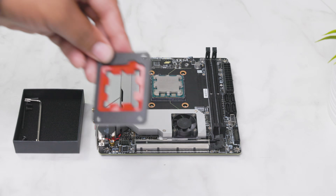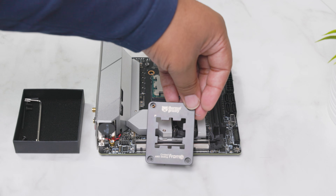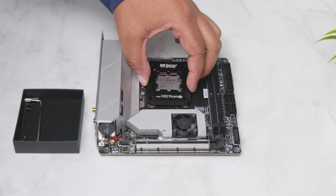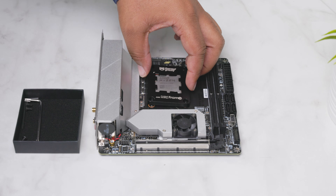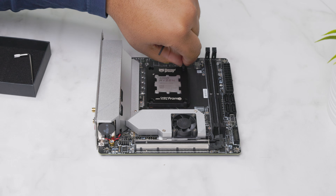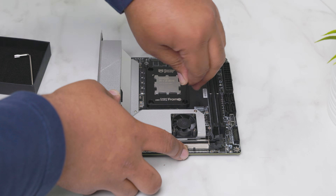I received this Thermal Grizzly contact sealing frame from a subscriber, and it has helped prevent thermal paste from creeping in — much appreciation to him. There is a silicone gasket that wraps around the IHS for a tight seal. These are tightened with four hex screws; screws and tools come included. I always use the X pattern — I think it really matters. Thankfully, there is no way to over-tighten these.